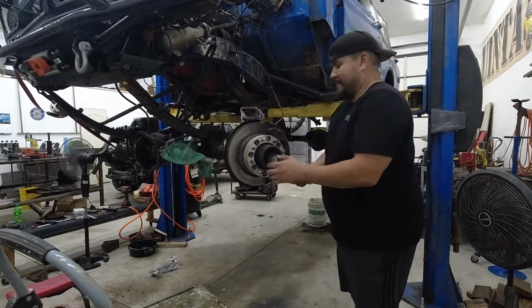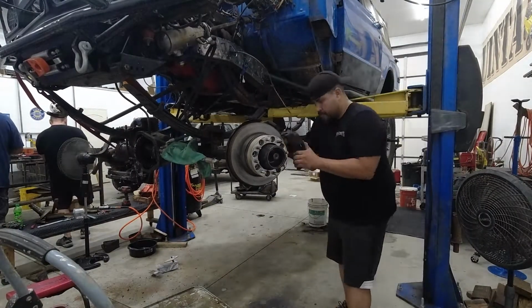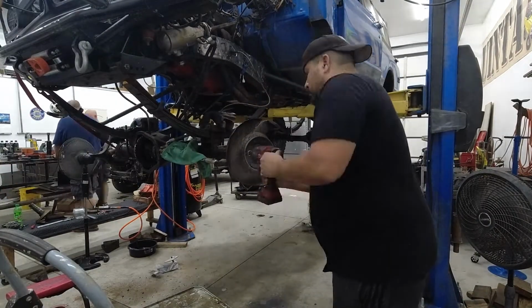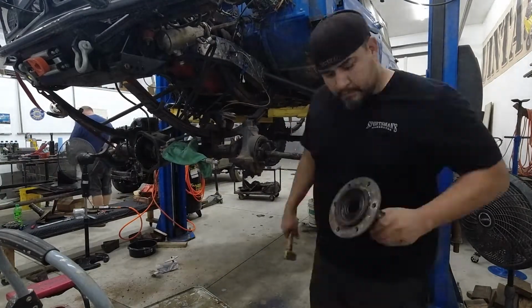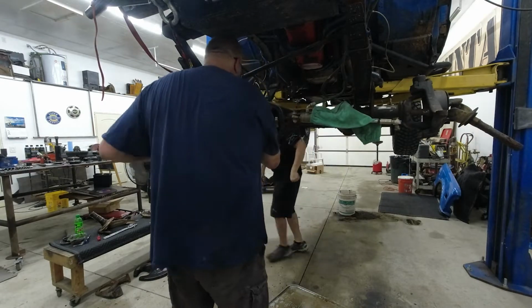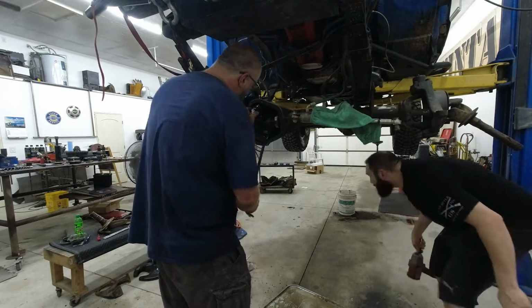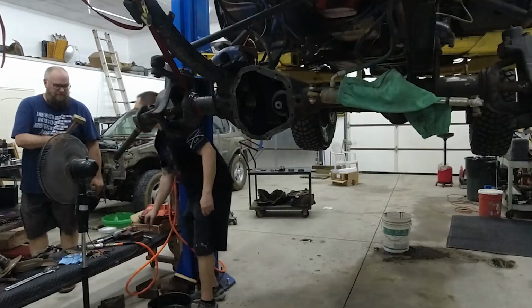Hey guys, and welcome to another edition of Uinta Garage. In the last video, we installed 538 gears for the 14 bolt in the back of the GMC Jimmy. You can find a link to that video in the description below. This time, we're giving the front Dana 60 the same treatment. Lower 538 gears, along with a front Spartan Locker, rounding out the upgrades. We'll be covering some of the tips and tricks Eric has learned from doing many gear installs over the years.